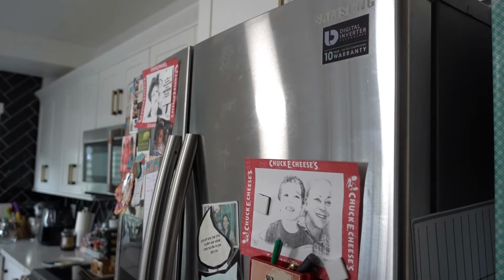I'm going to make an assumption, one of three things. Either there's no water supply, number two, the ice maker may not be getting cold enough, or number three, which is probably most common, I suspect that the ice maker's working too good, and for whatever reason, maybe the owner's not drawing ice cubes out of it frequently enough, but I think the ice maker is jammed with ice.